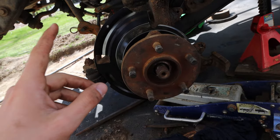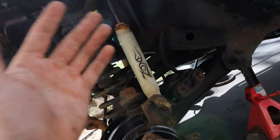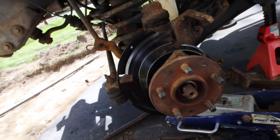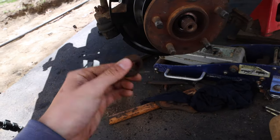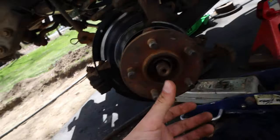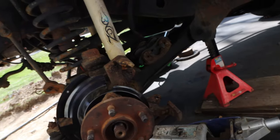That was almost very, very bad. I actually forgot to torque down the three hub bolts. I got caught up getting the brakes ready to put on. I said I was going to torque everything after and I almost forgot. So I'm going to go ahead and torque the three hub bolts, put on the big axle nut along with the cotter pin, the washer and all that, and torque that down. I think that has to be over 100 foot-pounds, so you really have to reef on that thing. Then we can move on to the brakes.